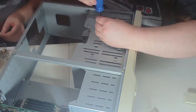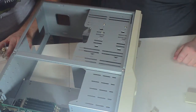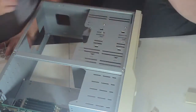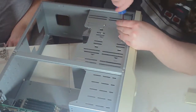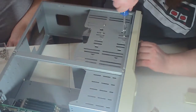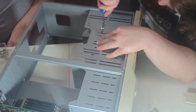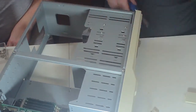Getting drivers for these things should be fun. Yeah, that'll be a whole other video, I suspect. I was going to get drivers off screen and then install it after we get them, and show the installation process for Windows, but not the getting the driver process. Drivers back then aren't like drivers now, where you have USB and plug and play. This is back in the day where everything was manual. So when you wanted a driver, you ran a program that did the install of the driver, or you copied it to the root of the hard drive, and manually loaded it from config.sys. How many of you remember config.sys? And autoexec.bat. How many of you want to forget config.sys? Well, we can't do that.